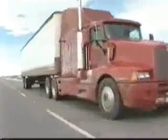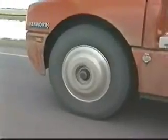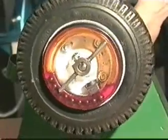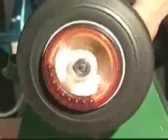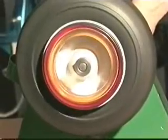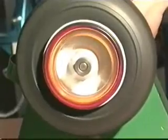The physics that make the Traeger Tabs unit work are astounding. As the Tabs unit begins to rotate, it senses any imbalance in the tire. This vibration causes the balls to move backwards through the buffer fluid in a feathering pattern opposite of the imbalance. When the balls reach the proper position, the buffering fluid stops further movement, and the balance is maintained.